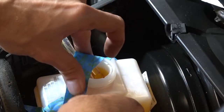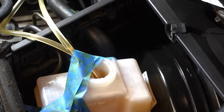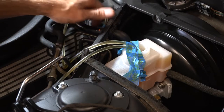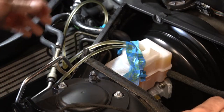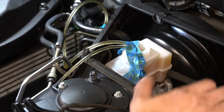Looks like an OR in here — I'm basically taping down an IV. Looking a lot better — still see a little bit of micro bubbles, but I'm getting full strokes of the brake pedal. Once you work up to that you'll see the air coming in and the bubbles releasing in the reservoir — therefore there's no air bubbles in the master. Now I've got the other line — the one going to the DSC stability control module — so I swapped from the ABS to the DSC. I still got a little bit of bubbles going to the ABS but I think I can flush that out when I do the rest of the system.